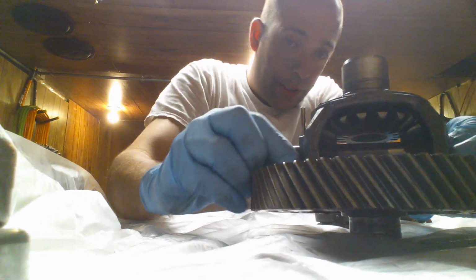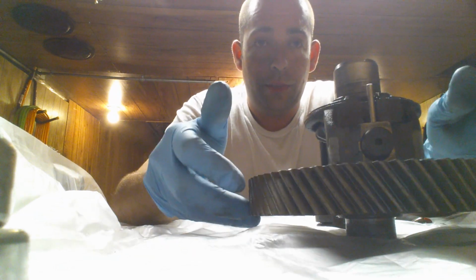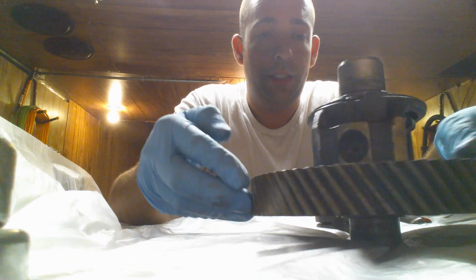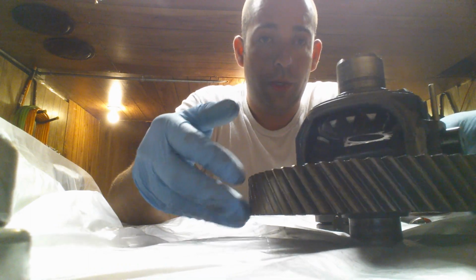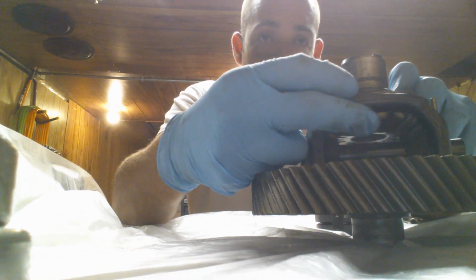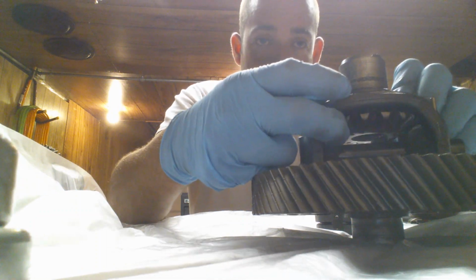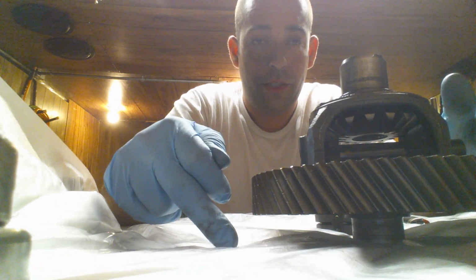if I guide this guy through just enough, here we go. What would happen is this. As the transmission turns the pinion, inside of course, from this point down is the passenger side, which is the shortest distance off the transmission, is the primary drive wheel. Okay, and in instances where there's high load, you dump the clutch, this guy spins on top, and he spins. This is the driver's wheel. This is the drive shaft that feeds the driver's side wheel. He can spin independently of the main drive gear and the passenger wheel.